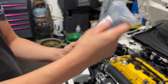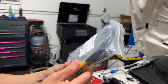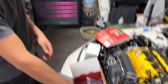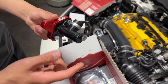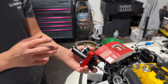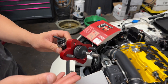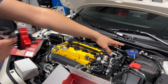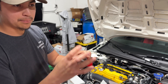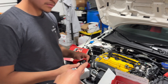You're going to get new braided hose, all the mounting brackets which go to OEM locations, new banjo bolts, new crush washers, and new OEM bolts for the frame. The kit is pretty well designed — we've used this on our Civic Si build. This year they went with the Wilwood upgrade, which FK guys use with great success. The billet adapter adapts the Wilwood to the FL5 frame itself, and it goes behind the battery, so we'll remove the battery and intake.